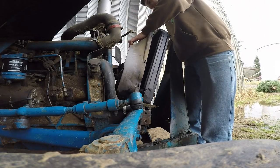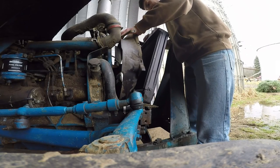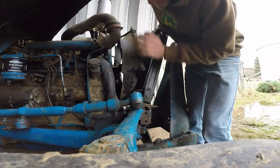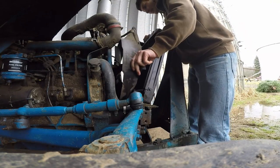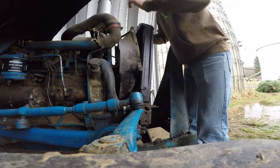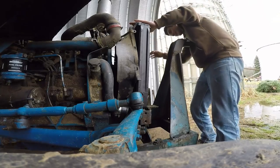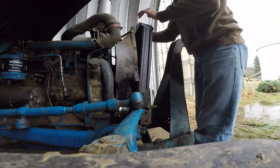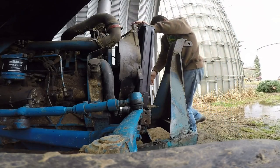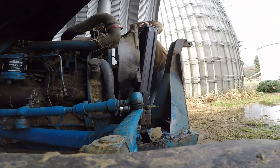These fan shrouds are the hardest to find piece of plastic. The 2910 — that one broke and we had to try to find a new one. Needless to say, we didn't find a new one, but we seem to be doing okay without a fan shroud on it. Put that thing back where it came from — this is probably how they get broken, right here when you're trying to put the radiator on. Looks like we got two bolts in. I shouldn't have put the stopcock back in.